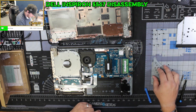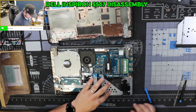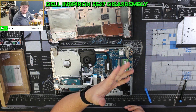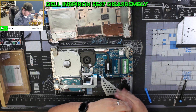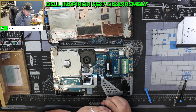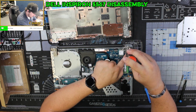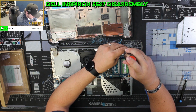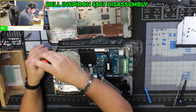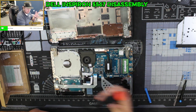We had the single screw — now we're going to take this plate and put it back in. You can see the plate already sits much better with the new battery. We'll go through everything in reverse now. Take the two screws and put them back in nice and tight. One other quick note while you have the laptop open: the hinges have a tendency to rip, so make sure the screws in them are tight. Don't put a lot of torque on them — just rest your screwdriver in the screw and give it a minor turn to see if it turns, then keep them tight.